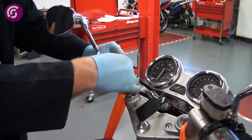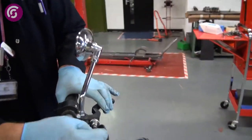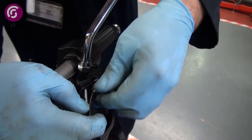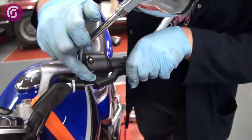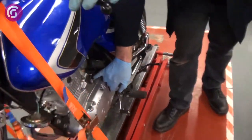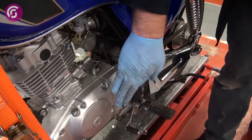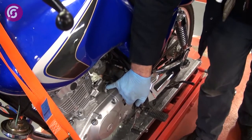When you're checking the clutch, you need to make sure that it's adjusted well — there's not too much play. Make sure there's no frayed cables sticking out; if you have a look there, that looks fine, there's no fraying. As you pull the clutch lever you can see the little clutch arm there moving, and what it's actually doing is turning a cam, which is what's moving the bar to disengage the clutch — as I showed you on that exploded gearbox.